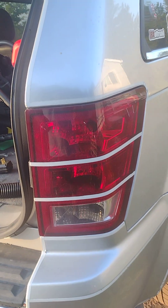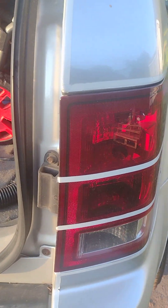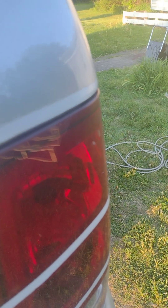I'm going to show you how to remove the tail lights on a 2005 Jeep Grand Cherokee Limited. They seem to be different between models — this one has Torx screws, not Phillips. The Torx is a T25, so make sure you use the proper Torx bit so you don't strip them out.